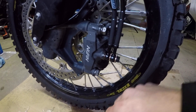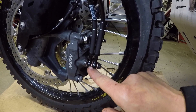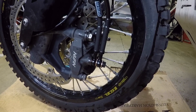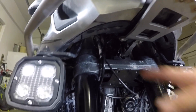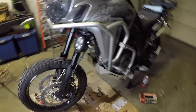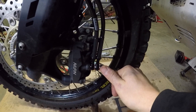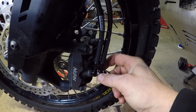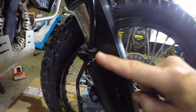One big thing to mention: when you have your fittings back on, make sure you put your washers correctly. This side does three — you have your bolt, your washer, your banjo fitting, your washer, another banjo fitting, and then your final washer. Make sure and don't leave those out because it will leak. Your main brake line and ABS line come up over the lower part of the triple tree, up and around, and hook there. There's a zip tie there, then it comes down to another zip tie, and that's the right side top banjo connection. Then you have your other banjo connection that comes up through here, around to that zip tie, across the other side to this zip tie, through that zip tie, down to here.